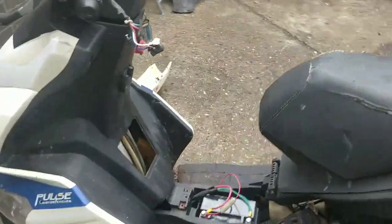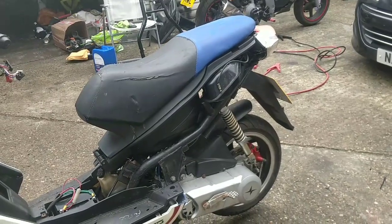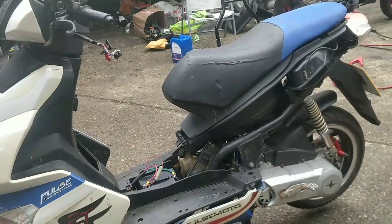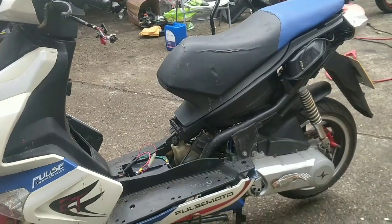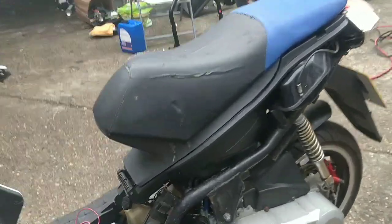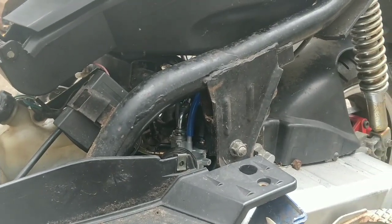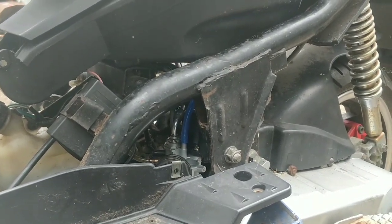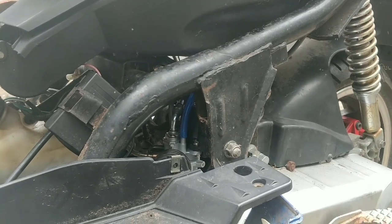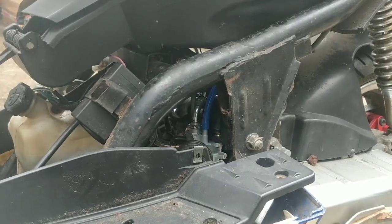Let's pull out the Piaggio Typhoon. Yeah, let's go and pull that out. I'll chuck this to the back for now, because we have some idea of what's going on, kind of roughly. It seems to be running out of juice quicker than it should. It might need a small down jetting by maybe 3 or 4, ideally, and maybe the float valves are cutting off a bit early. Maybe we need to cut them off a bit later. That should kind of solve that issue there.